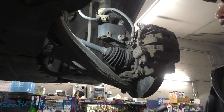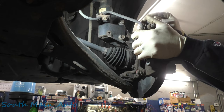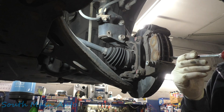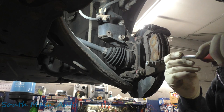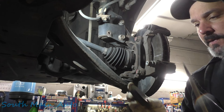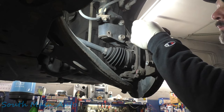Once we have a look at these, the caliper seems to push in there. Pads are just about shot, probably 10% left. That's really not too bad for 70 some thousand — stuck in the bracket a little bit. Not completely wasted but getting down there pretty good. The effort was a little bit high for the amount of stopping power he had, but he might have had another five or ten thousand miles left in those pads. Seemed to be worn pretty even, bit of a rust ridge there.